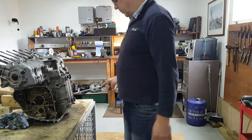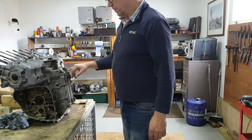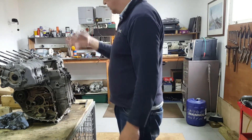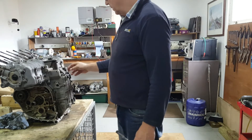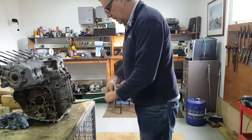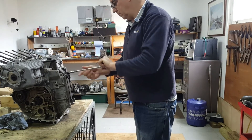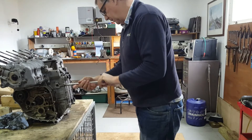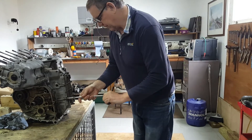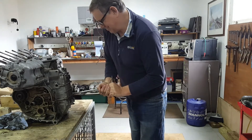I've just been cleaning up a bit of oil — inevitably when you're pulling these things apart you get some residual oil in there. What I do is remove one of the plugs off the bottom of the crankcase, under the crank, and drain it out of there, because that's inevitably where they leak. So what I'm going to do now is remove the sump and we'll see what mess is waiting for us in there. What we're going to be looking for is any white metal that may be residing in the bottom of the sump. The wear on that number four big end is fairly minimal, but we'll see. I've also got to still inspect the oil filter which I'm just letting drain down at the moment.